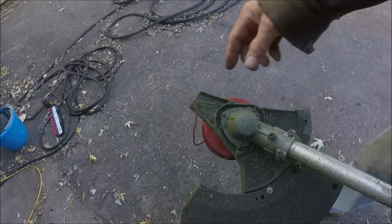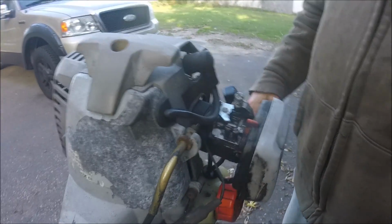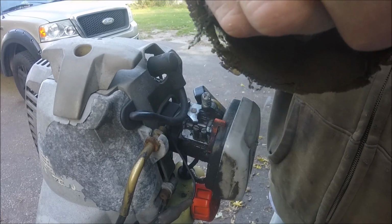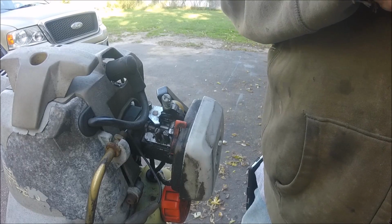And then I'll make a chainsaw one after this, but this is a weed eater. First off, make sure that your line is cut off to the proper distance. If you have the line really short, it'll change the load on the motor. So make sure the line's all the way out so you have the proper load when you're adjusting it that way. Now that we know the line is out properly, we can take the load.